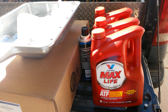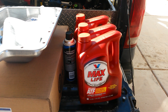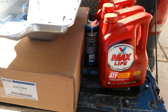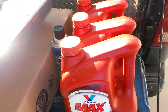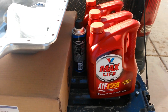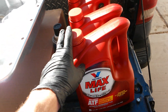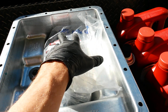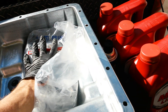The theory with the hot flush machine is that unless you're heating the incoming fluid, the transmission thermostat is going to close and the fluid won't even go in. On my old transmission, I found that it actually stayed open at a much lower temperature than a lot of people say on the forums. At the very least, you want to do a drain and fill with genuine Ford fluid. Or if you're going to switch over to Max Life — which I have done and many others have done — you want to upgrade to a better filter so anything the new conditioners stir up gets caught and you're going to be okay.